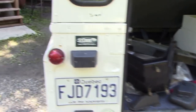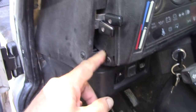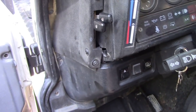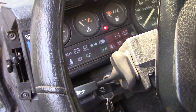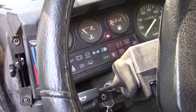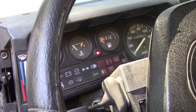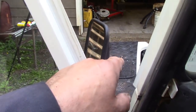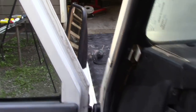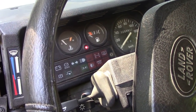One of the things I'm going to do is the binnacle support — it's got the obligatory crack in it. I've got a spare one in metal that Paul sent me from the UK, so I'm going to change that because the current one is bloody awful. It's got an LED light for an alarm, but it doesn't switch the car off. I've a feeling somebody's fitted a 10AS alarm system and perhaps a Spider immobiliser — all the wires going to the injector pump are black. The sounder under the front wing has been taken off, so I think I'll put it back to standard whilst I'm under the dash.